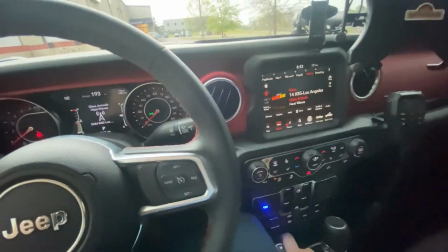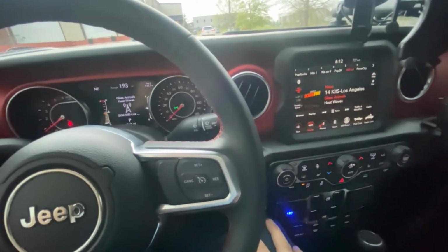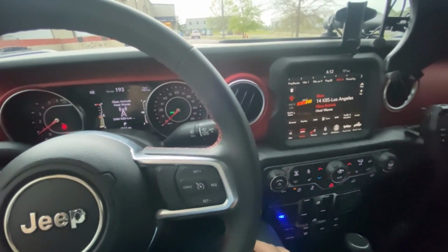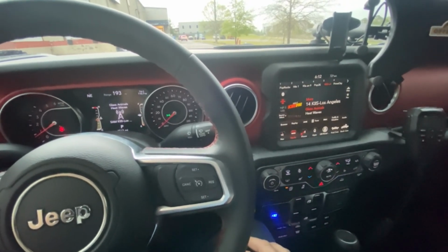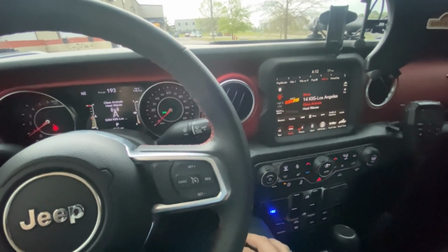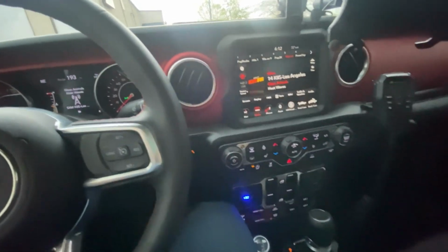well. So in four-wheel high, it doesn't do that on-off thing when you're on the trail and you just want the sway bar disconnected. That was my number one thing, is I wanted to have control of the lockers in four-wheel high, and I wanted control of the sway bar in four-wheel high while I'm on the trails.